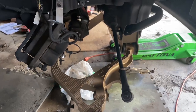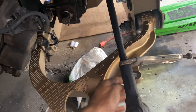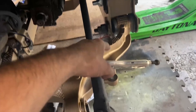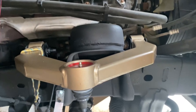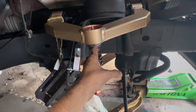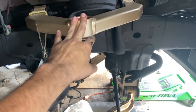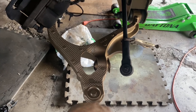One thing to note: make sure the lower and upper control arms are placed correctly — they do have a side. It's a giveaway because the tie rod is there. You can see this side is long and this side is short. On top, this side is short and this one is long. I happened to get these right on the first try — I looked it up to make sure. That way the bolt aligns straight, otherwise it would be a little off and a waste of time. Make sure they're set up properly — if you have a different vehicle, look it up.